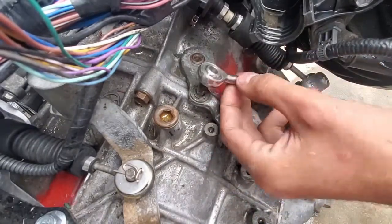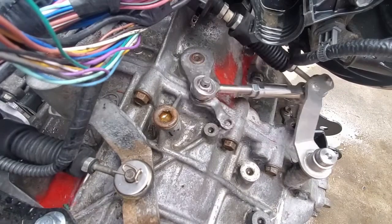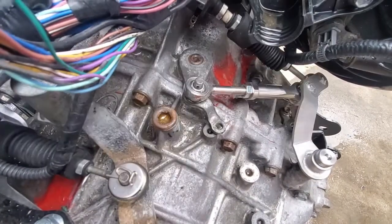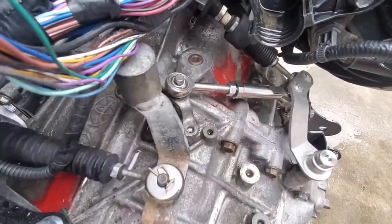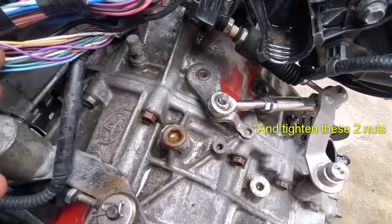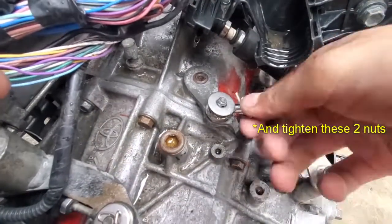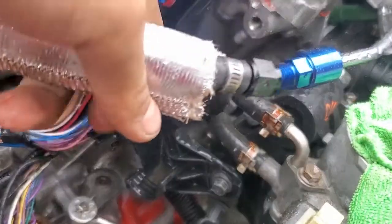Before finalizing the install, the adjustment bolts need to be calibrated. As I mentioned previously, I installed the small center field correction inside the chassis, which makes this step easier for me. I just have to keep unscrewing the bolt half a turn at a time and shift from inside the cabin. After numerous adjustments, the 3-4 gate is easily shifted into when the shifter is at its center. Now the shift mechanism is completed by installing the retention clip.